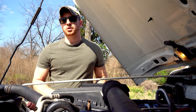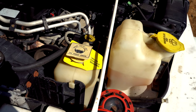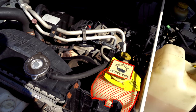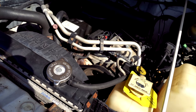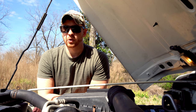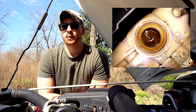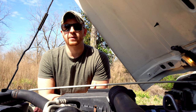Next, take off the radiator cap or just look at the coolant reservoir. Right here is the coolant reservoir tank. You want to make sure it's a clear tank - by clear I don't necessarily mean the plastic is easy to see through, but that the water is not murky. There are two things to look for: one is called a milkshake, which is when your oil mixes with your coolant - once again indicating a head gasket issue. Or if someone put some sort of sealer in there, you'll see weird brown chunks floating around in there.